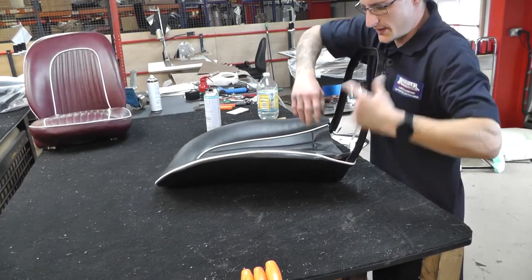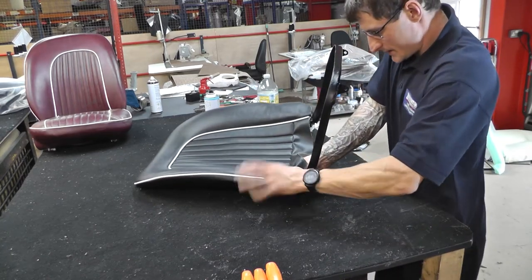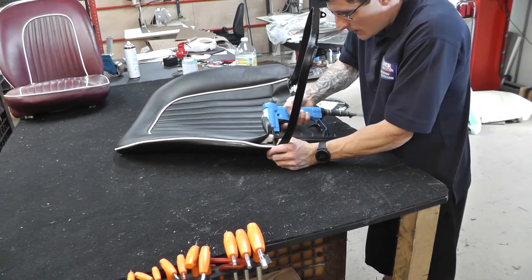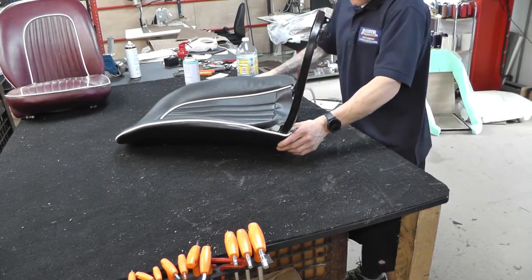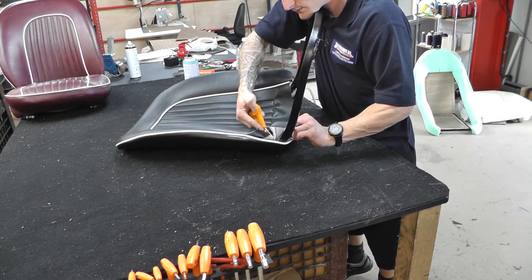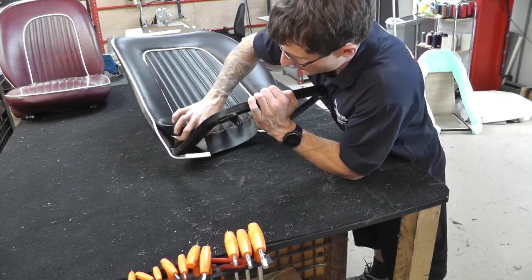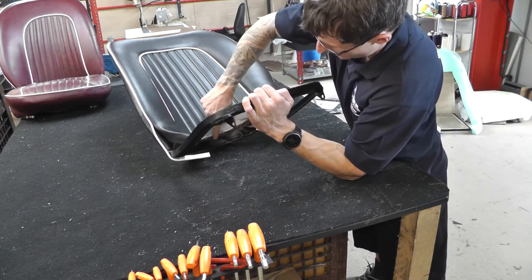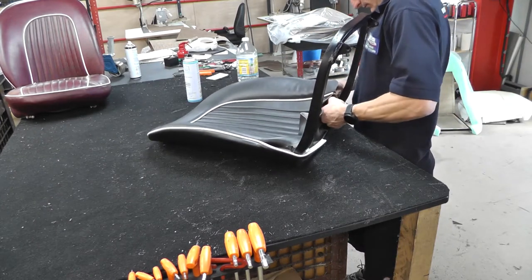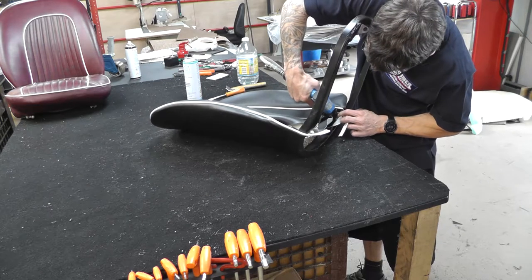Cool. And now all we've really got to do is finish off this bottom section. So we're just going to staple this internal flap first. Notice there's a little bit left flapping about here, which we need to just fix down. So just fix that right there. Trim off any excess. And what are you stapling that into? That's the wooden strips that we put in at the very start. So the wooden strips just sit either side of the middle. Like that.